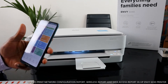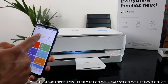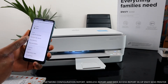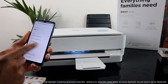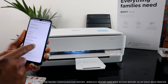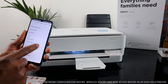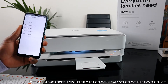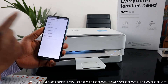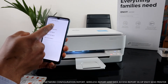To print out the network configuration, go to the HP Smart app. Inside the app, click on your printer. You will see options including: print anywhere, print from other devices, quick reference, supported supply, general printer display, light settings, paper quiet mode, and printer reports. Select 'Printer Reports'. Once you select Printer Reports, you can choose to print the printer status page or network configuration — select whichever you need.